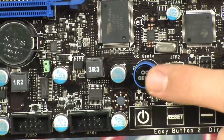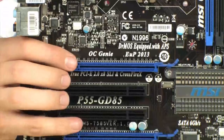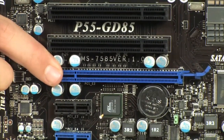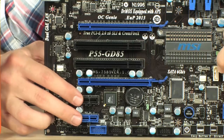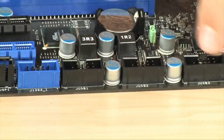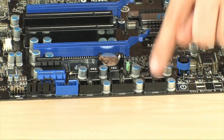I've seen up to 3.6 gigahertz overclocks with just a push of the button in less than a second — pretty nice as far as performance is concerned. Now let's talk about PCI Express slots. As far as PCI Express X16 2.0 slots go, you have two. These work in X16 mode with a single card, or bifurcate down to X8 and X8 with two cards. You also have two PCI slots and two PCI Express X1 slots of the 2.0 specification. There are also a lot of USB headers on this board — six extra ports over here, as well as an additional Firewire header. If you have a lot of peripherals and need a lot of USB 2.0 ports, this board is right up your alley.